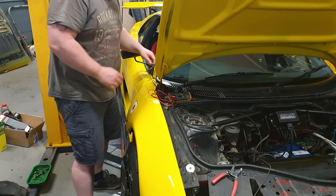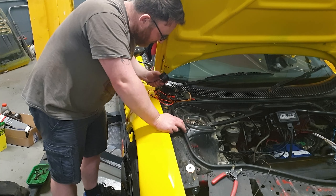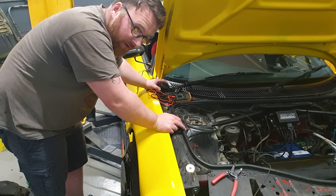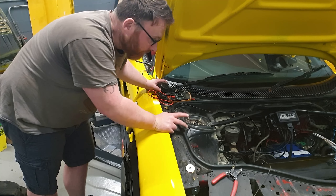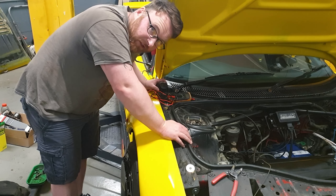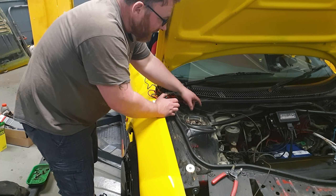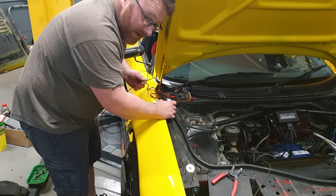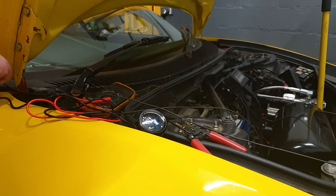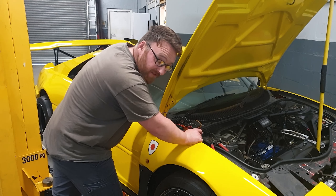The wee red wire running to the gauge goes into the car near the dashboard. I've got it sat here onto the loom for the sensor — there are two more wires I'm going to have to run: a positive and a negative. The positive should really come on with the switch live from the ignition, otherwise the gauge will give you data when the car's off and flatten your battery. For the moment I just want to make sure this works, so I'm running a positive and negative straight to the battery as test flying leads. That should hopefully give me a gauge that lights up and reads around 10 to 20 degrees.